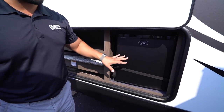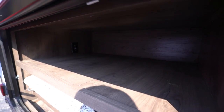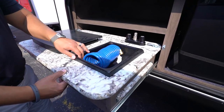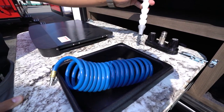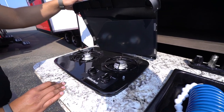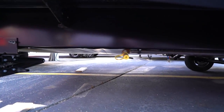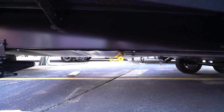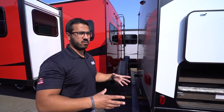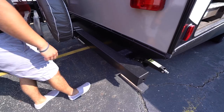In the very back, one of the things I love about bunk units is you often get an outside kitchen, and that's exactly what you have here. There's a mini fridge perfect for beverages, a condiments shelf up top that's a good spot for paper plates or solo cups. Right here is your pull-out cooktop, a wash basin with a faucet that hooks up simply, and over here is the two-burner cooktop for cooking outside. You need propane, and the propane line hooks up underneath where you'll see the propane quick connect. You can also hook up a grill here — just make sure you don't have a regulator on your cooking device since you already have a regulator up at the tank and you don't want to drop that pressure twice.